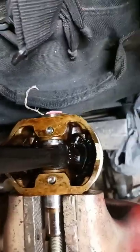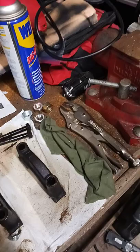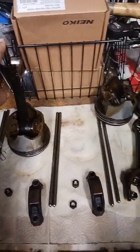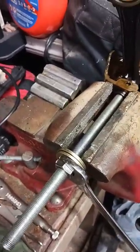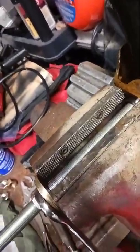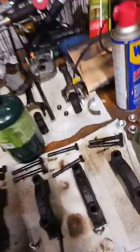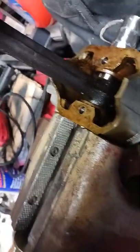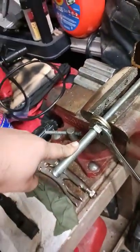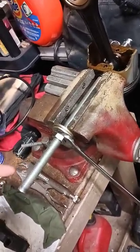Normally that would be an issue, but since it's spinning and there's still pressure on the other two nuts, they're still pulling through. So here we sit amongst all the mess trying to remove wrist pins from pistons. As you can see it's working — I still have two more to go. A friend suggested I put these videos up since, like most of you, I don't have money for a hydraulic press. You'll see a lot of Harbor Freight for that reason. I ended up making a wrist pin puller out of four nuts, two washers, and some all-thread — this one's 14 inches, but realistically it could have been about 10 to 12.